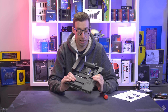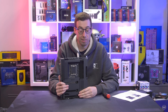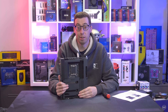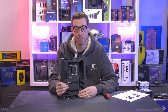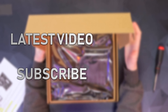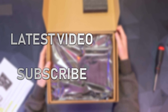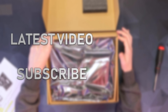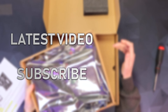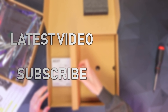This will support a gen 5 graphics card, but your storage will be limited to gen 4. So as I was saying at the start, if you're happy with gen 4 and don't think you need gen 5 storage, this will save you money. There's the first M.2 storage slot with a built-in thermal pad for heat dissipation, supporting up to an 80mm drive. The next slot supports up to 110mm. There's also a small slot with the Wi-Fi 6E card in it, and then a final slot on the bottom which is another 80mm slot.